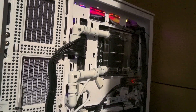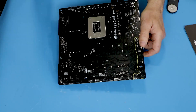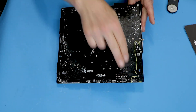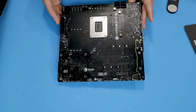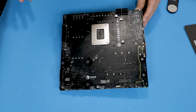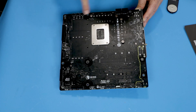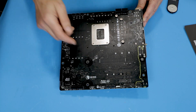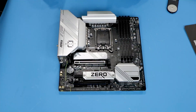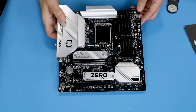Almost without any power cables, with the exception of the GPU which has its own power connection — so you still have one cable on the front, but everything else can be hidden. This type of connection creates an additional twist: because you have all the stuff sticking out on the back of the motherboard, you cannot use most existing cases and need one with cutouts for those additional connectors. Also, based on reviews I looked at, you need to be mindful of leaving all those connections accessible and free of cable clutter. Thank you MSI for providing this motherboard — it's a very tricky type of installation.